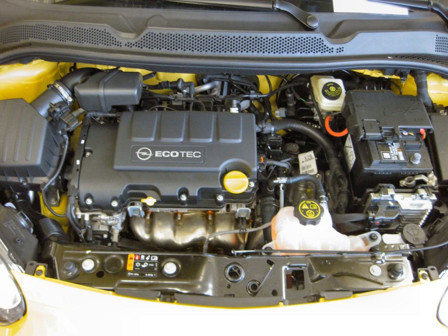The second generation Family Zero began production in November 2002. It is an updated version of the Family Zero engine and features twinport technology — twin intake ports with a choke closing one of the ports at low RPM — providing strong air swirl pattern for higher torque levels and better fuel economy. The crankshaft and oil galleries were also redesigned to lower power loss, thereby increasing fuel economy.